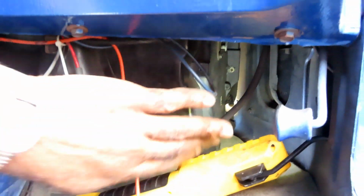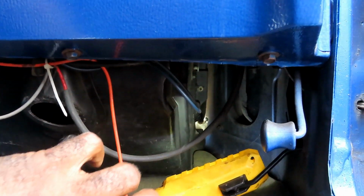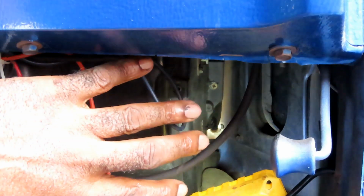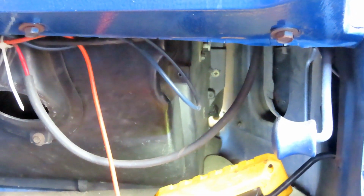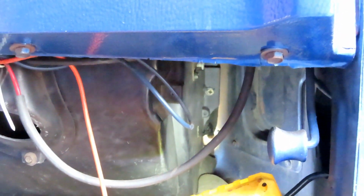All right. So, having that open, now that blower motor can only pull in air through this door right here. So it's going to pull air in from the outside. You can say, oh, Tim, what if somebody... well, nobody has any business being in my van, man. It's my van. What happens if you make a mistake and close that off? That can put a drag on the blower motor and cause it to go bad.